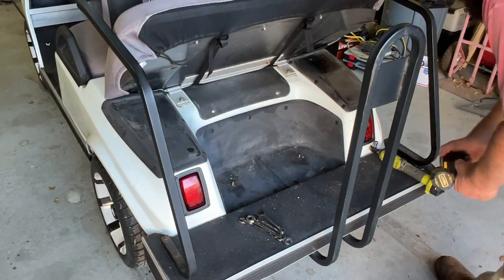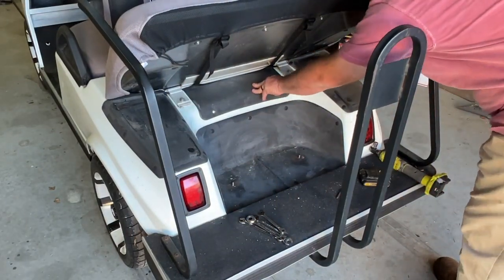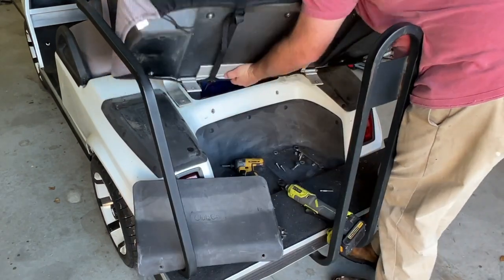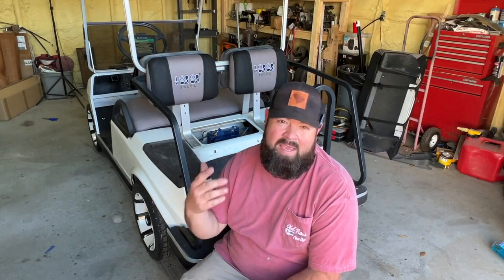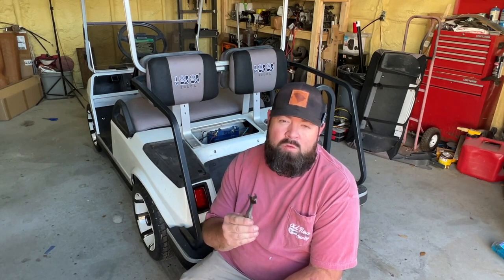To make it a little bit easier, I'm going to remove the motor and controller access panel so we can get to some of the top bolts on top of the motor. I'm also going to remove the seat before we drop the rear end. You're going to need some basic hand tools to complete a job like this. In order to remove the cables from the motor, you're going to need two half-inch wrenches.